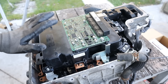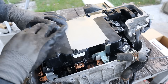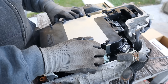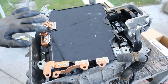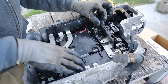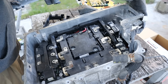It's easier to explain how this works as I take it apart. At the top we have our little control module which interfaces with the vehicle's CAN bus. Next up we have our smoothing capacitor — this one smooths out those AC sine waves coming in from the electric motor during regenerative braking and turns them into direct current to charge the high voltage battery. It's rated at 750 volts and 972 microfarads. On the bottom of the capacitor we've got DC coming in from the high voltage battery — one line goes to the DC-to-DC converter, the other gets DC current directly to the four-wheel drive module.